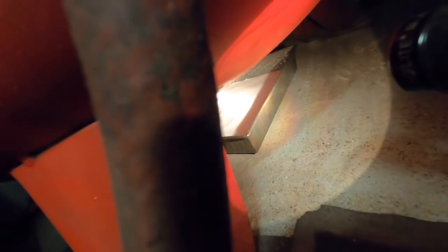That is the drain for the air compressor tank. What I do is crack this open a little bit. Let me get that loosened up and I'll show you the water in the tank - it's pretty typical to get water in compressed air. The white is because you get a little oil from the rings in the compressor. This has probably been a month since I've drained the tank, so I just open that valve enough to let the water out.